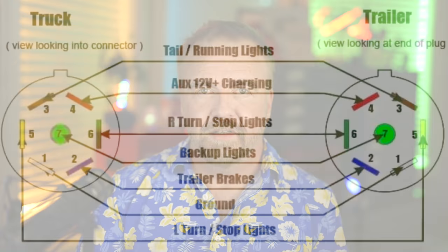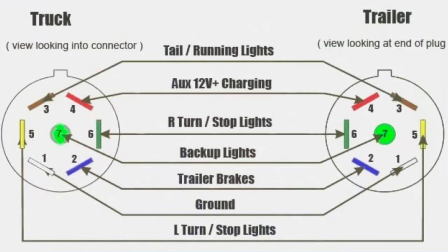I think we should assume the most common case on a truck: the 7-pin trailer plug. That means we only have the most basic signals: tail lights, left turn, right turn, backup, power, and ground. The brake signal is not active unless the vehicle has an electronic brake controller. You can also do it with a 5-pin if you're willing to source power separately, and even a 4-pin if you can forego the backup feature. A suitably experienced tech could also interface with most older vehicles by tapping directly into the taillight wiring.